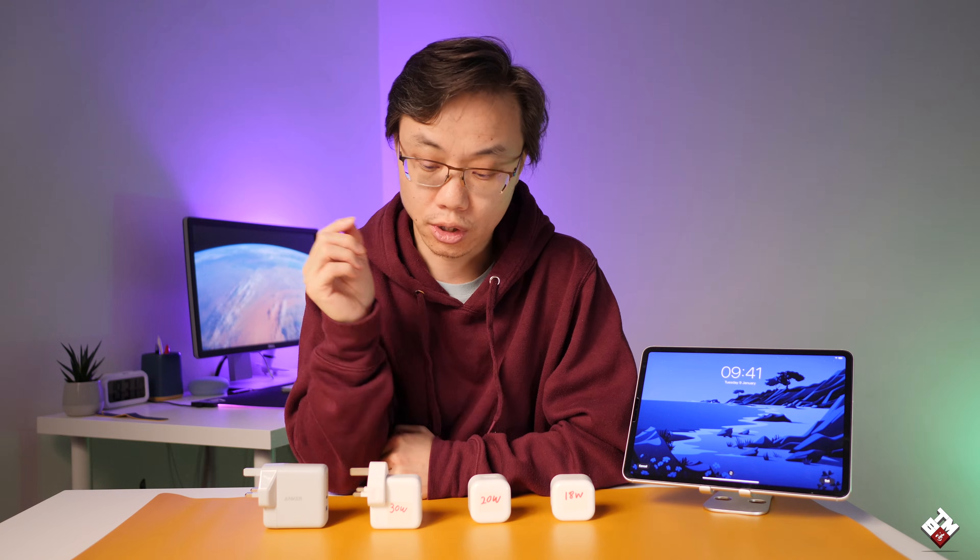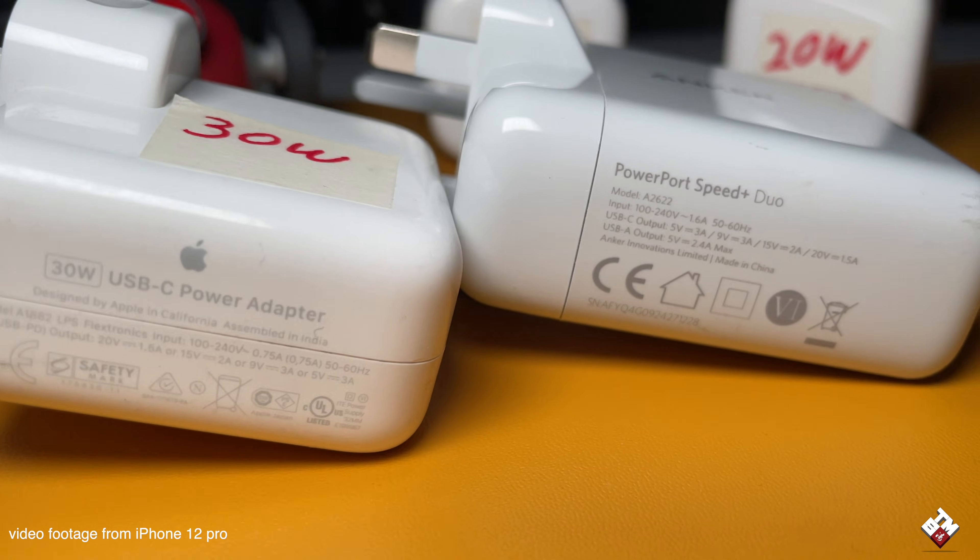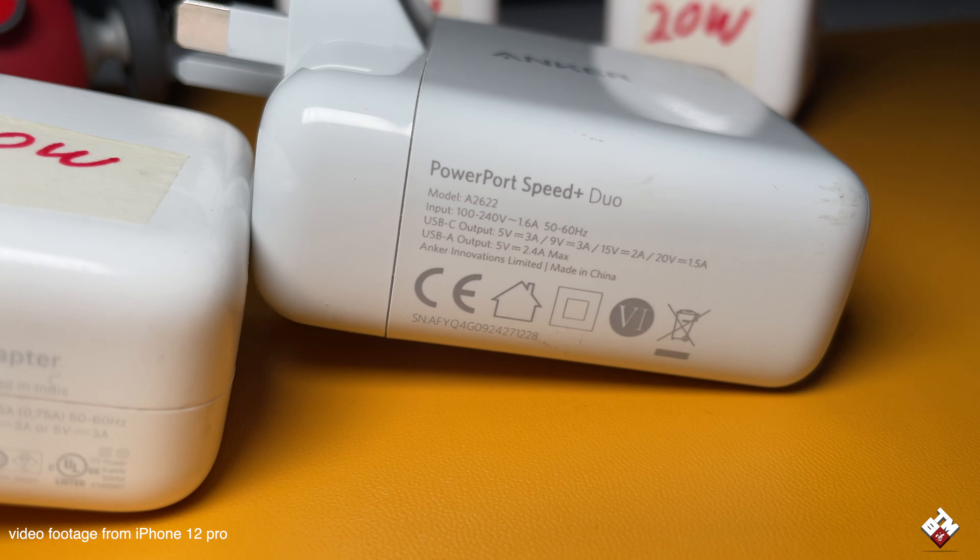The second thing we've learned is that the iPad Pro is actually capable of up to 24 watts fast charging at 15 volts. The 30 watt charger is capable of 5V, 9V, and up to 15V, so when doing fast charging the iPad can take up to 24 watts. However, if you have the new 60 watt MacBook Pro charger, you won't see any faster charging than that because the iPad Pro is capped at around 24 watts.